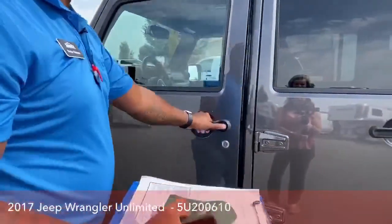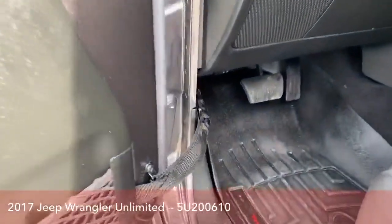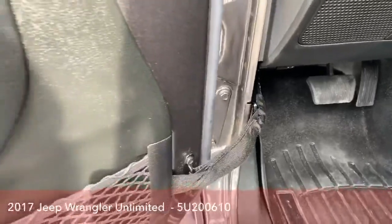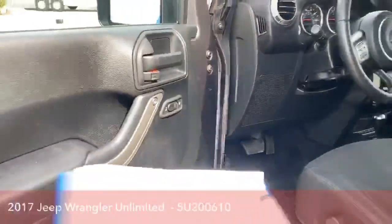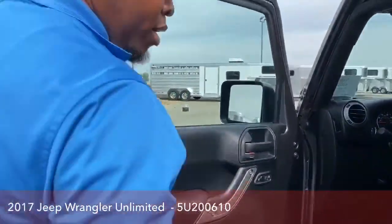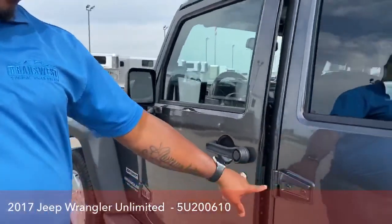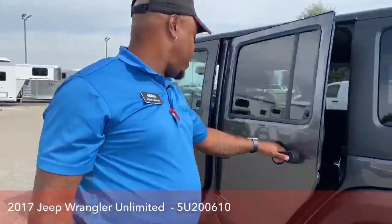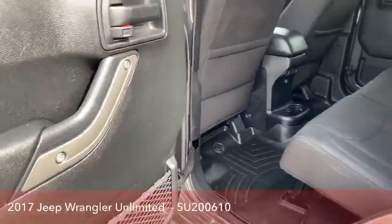Inside, it does come with a little strap. You have to undo the strap — there's a little harness underneath the steering wheel. You take that off, and then once all the hinges are off, all you got to do is lift the door out of the hinge. Same for the passenger side — we got two screws as well here, and one more strap. Remove that, and of course that door comes out.